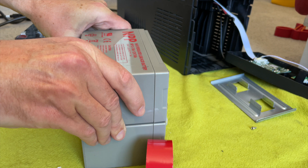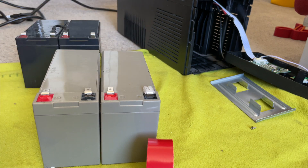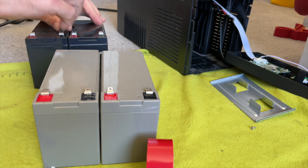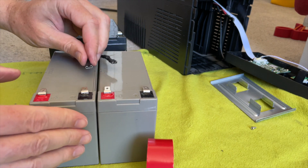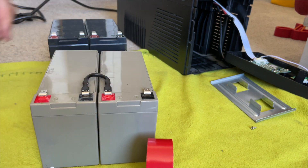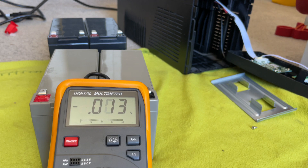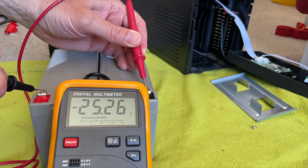That's quite a lot of money and you can get a cheaper brand for about half the price, but I figured I didn't want to skimp and wanted them to last another five years. Before you slide them in, remove the patch cable from the previous pair and attach it to the inner terminals of the two new batteries — one is minus and one is plus — because the two batteries are in series, which means 12 volts add up to a total of 24. I measured that with my multimeter and it's about right.